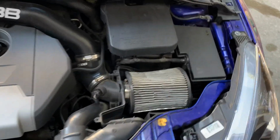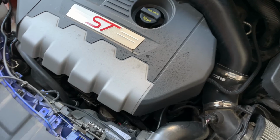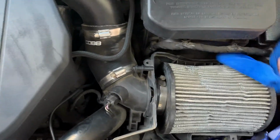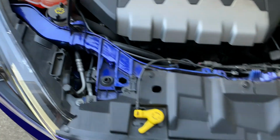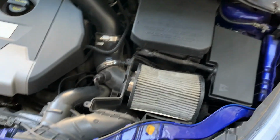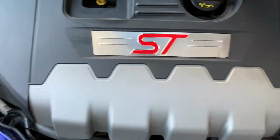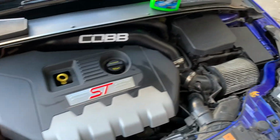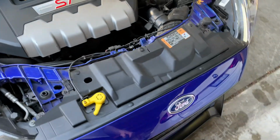You can also wipe the engine bay down, some of that dust there. I don't like to wash the engine. Did it before in a different car and the alternator went bad. So be careful. Shouldn't power wash that engine. A lot of electronics there, you know. So it might not start. It'll turn on later. Just a little wipe is good enough. A little wipe off the dust. Looks good. You can put some tire dressing on too if you want, if you like it shiny. But that's what attracts the dust, so I don't know. It's your choice.